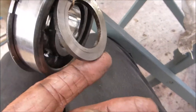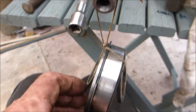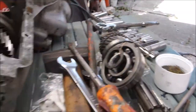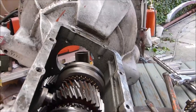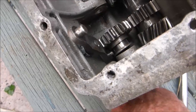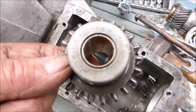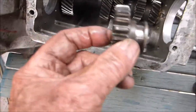The inner washer and the one on the inside of the gearbox — those are tied together and put away with the rest. Now when you push the shaft in, you'll find there's enough room to bring it out. That's the reverse gear — push this shaft out and the gear will just drop into the bottom. Lift it out with the bearing intact. That's your reverse; make sure it goes in the right way around.